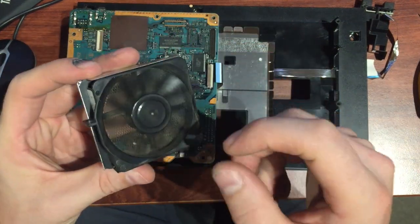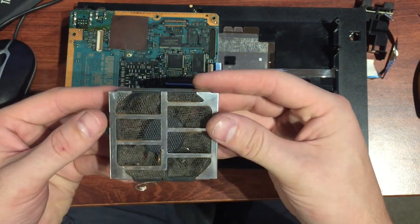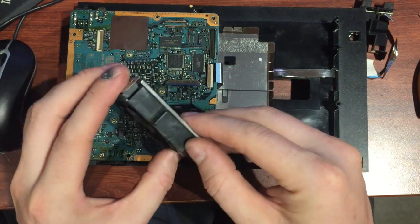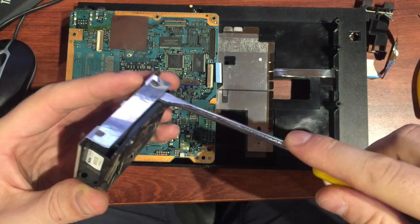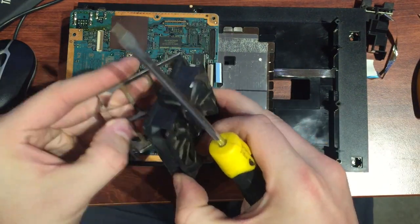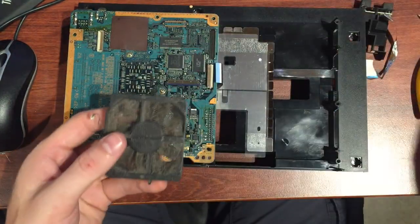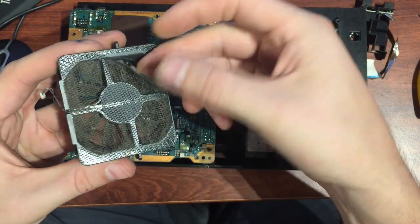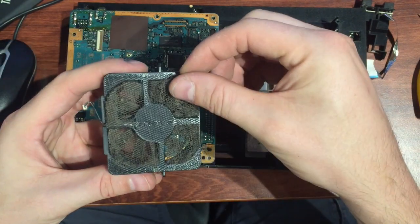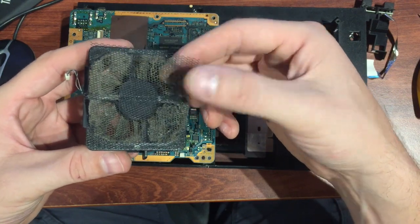The fan's out. Make sure it spins okay and doesn't make grinding noises. I'll clean it out with compressed air. I'll pull the shielding off as well and try to repair the mesh that's in behind here — put your screwdriver under those clips and that'll come off. On the wash pile. The meshy grill is absolutely filthy. We could just easily make a new one out of some fly screen — just go to a hardware store and cut it to size and glue it on.